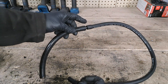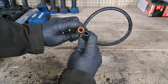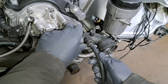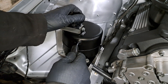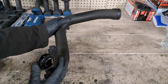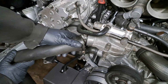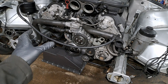Next up we have this return hose, which leaves the upper radiator hose and goes directly to the expansion tank. We have a little barbed connector to conjoin the two different hose sizes. We take one side and put it directly onto the barb, then the other end goes onto the expansion tank. Finally we have the last hose — an unmodified M5 hose — which goes right here.